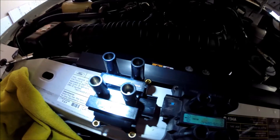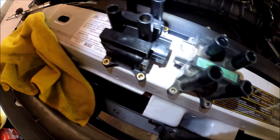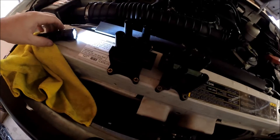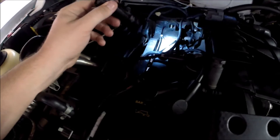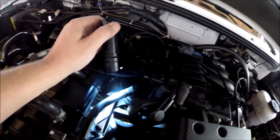I'm going to take these bolts out, but then we're going to compare the original Motorcraft Ford coil to the Spectrum and see how it stacks up on a visual inspection. As you can see, the design is exactly the same — it's just backwards, that's why. The diode placement, the little connector in there, just about the same. The nice thing is the new one is numbered: one, three, two, and four. As far as underneath, they both have the same kind of insulation — a very hard, maybe polyurethane coating. The old one is just a little dirtier because it was in the truck for so long.